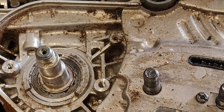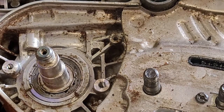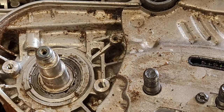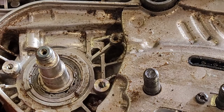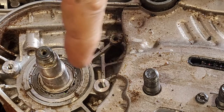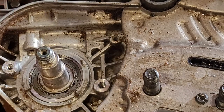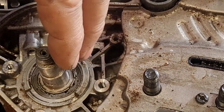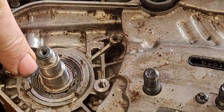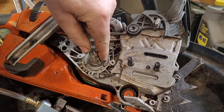Whether or not it's a result of the nylon cage — what I've found in the past is when the bearings go, it's because that cage tears apart. The trouble is that the nylon cage only has, I think, eight bearings in it. If there's too much torque on the crankshaft pulling against the bearings, the nylon ends up opening up, and when that happens all the bearings end up going to the back side here, and the crank is actually able to move ahead a bit.